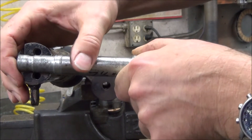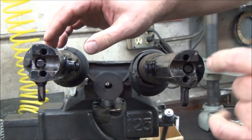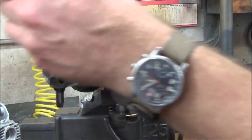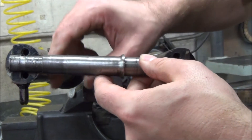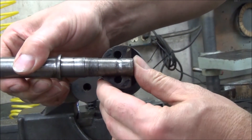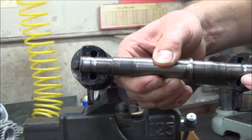So be mindful when you go together — without any pressure on the fork tubes, those bolts should line up with the little cutouts in the axle, without having to spread or do any manhandling. It should go right in. And if they don't, then you need a different axle.